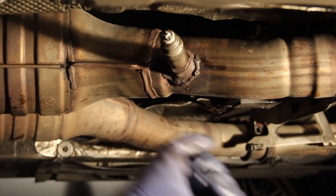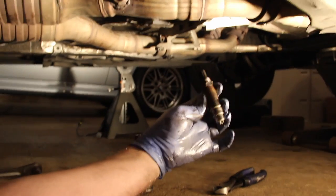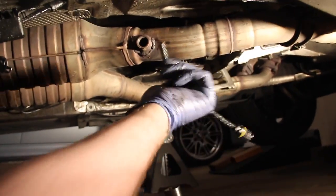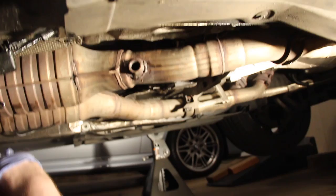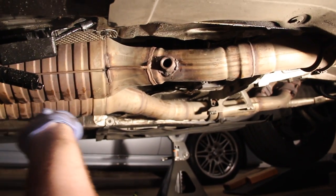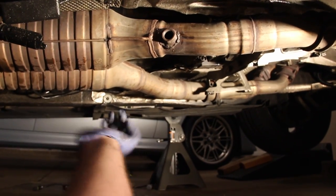Now backing it out — it comes out quite easily once you've broken the torque. Nice and crusty; you can see the carbon coming out of there. If you run into problems, I definitely recommend using half-inch drive tools for this. You can try a breaker bar or a pipe for more leverage. If it's really not coming out or something bad happens, you're going to have to cut the exhaust pipe out and weld in a new bung. If it's stuck, try tightening it a little bit first and then loosening — sometimes it's easier to move it forward and then backward and it will come out.